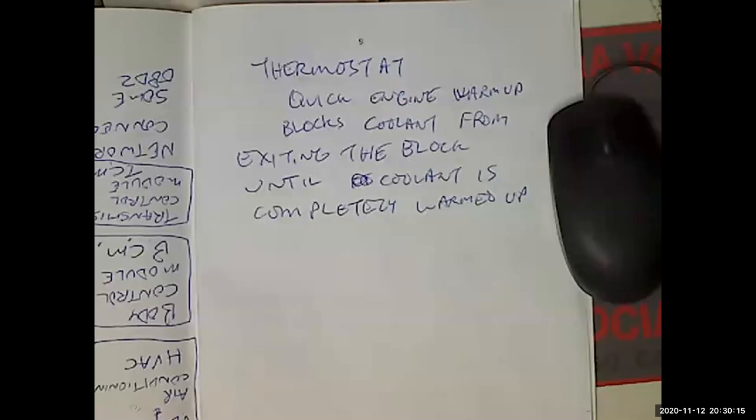But look at the stakes, right? If your coolant turns acidic, it's going to start eating at your freeze plugs and stuff like that. That turns into bad. Can you imagine having a four-wheel drive truck and the freeze plugs go bad? Good luck, buddy. Okay, so the correct way to do it is flush. That needs to be carted away by an actual recycling company. Sure as hell don't pour it in the drain.